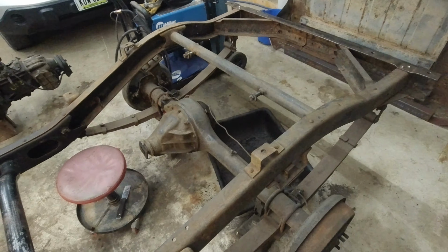I also have my Milwaukee one, which I usually just use for cutting because the battery goes down pretty quick when you're trying to use a wire wheel because it pulls on the battery. It takes a lot more amperage, I guess you could say, to spin that. So let's get this on here, and then I might put one of these other wire wheels on this one just so I can get in different locations and switch between the two and get the rest of this done.